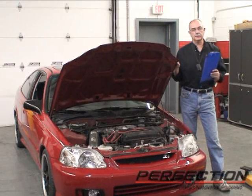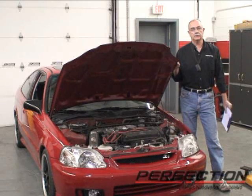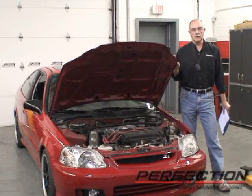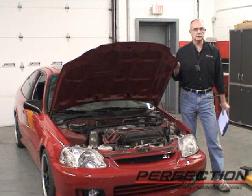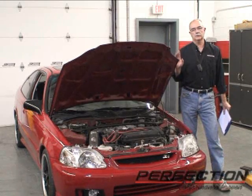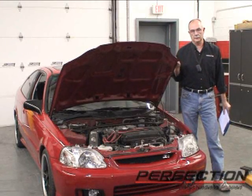Today we've got a 2000 Civic SI 1.6 liter VTEC with about 169,000 miles on it. Now I've taken it for a test drive, shifts just fine, no slippage, but we've got a little bit of a strange noise we're going to diagnose. The owner reports he hears it, and the only thing that makes the noise go away is when he pushes the clutch pedal all the way down.